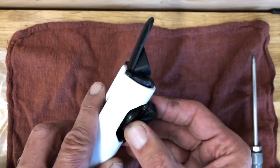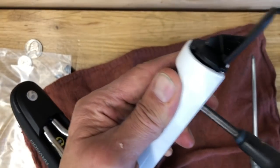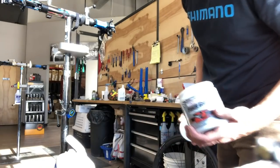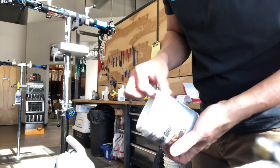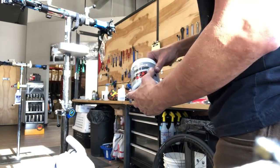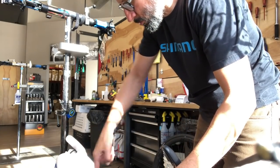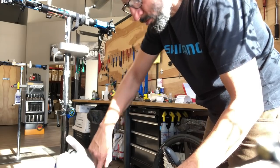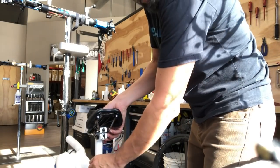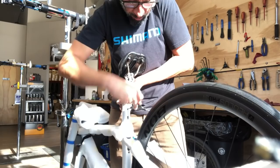Got all the critical pieces greased up and ready to put it into the bike. I backed the bolt out just enough so it wasn't protruding to the other side. There's a slot on the frame and if you have the seat post fully extended it covers up the bottom of that slot so water doesn't get down inside the frame. Using some carbon fiber grip paste — good to use on carbon seat posts, carbon-on-carbon, aluminum-on-carbon, and even dropper posts — so you don't have to get the torque super tight.